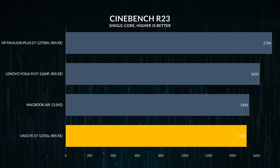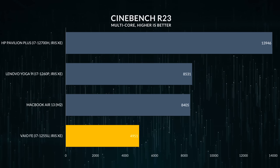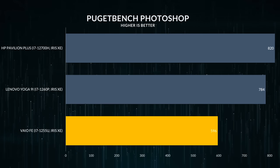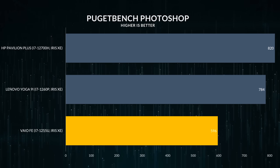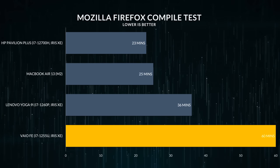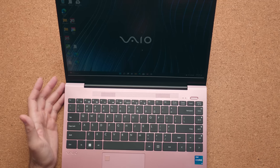For the one person out there who really wants this: the i7-1255U is Intel's 12th gen U series, very similar to last year's 11th gen — slightly faster single-core clock speeds, but multi-core speeds are not much of an upgrade. You're better off with a P series or H series from Intel. The Iris Xe is starting to show its age, so I wouldn't buy this to edit videos. CPU performance is adequate for general productivity and browsing. The fans kick on for anything — load up a web page and the fans are on, though thankfully maxing out at 40 decibels. It keeps the CPU cool but power throttles to do so.